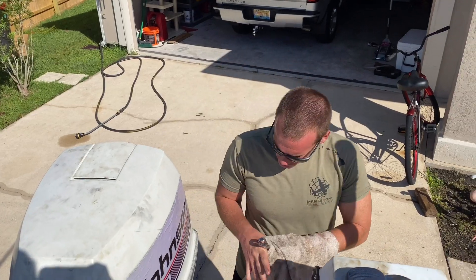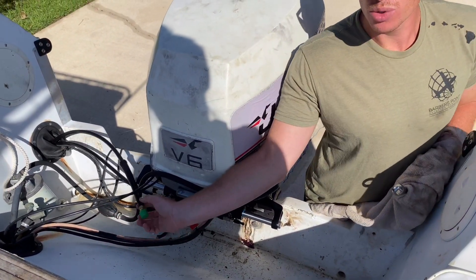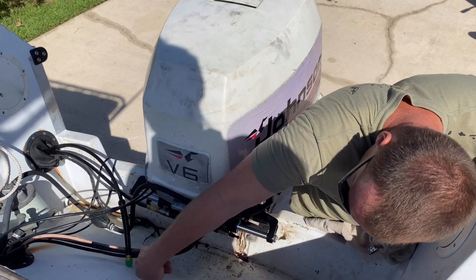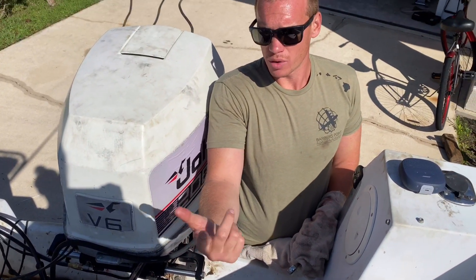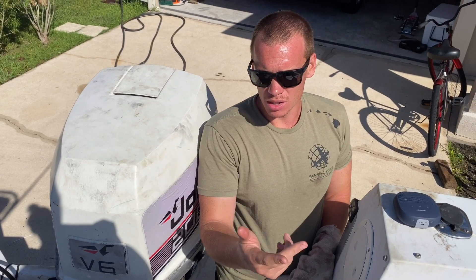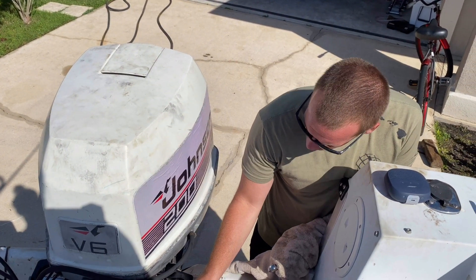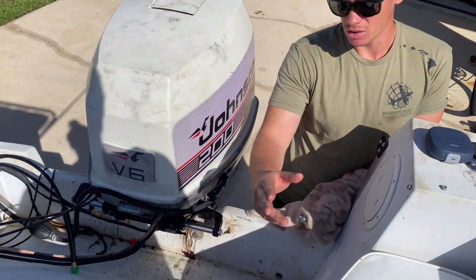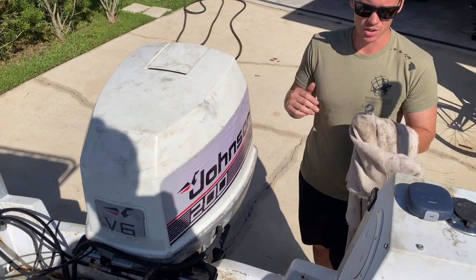Just as a quick tip: leave the cap on the one you're not going to install and do one at a time. For instance, I'm putting the red on the right — I'm going to go up in the center console and put the red on the left. Once I've got the red on the left, it's foolproof at that point — then I'm going to put the green on the left and then the green on the right. Do one at a time so you don't confuse yourself, take all the caps off, and wonder which one was it.